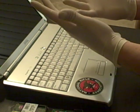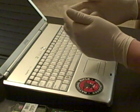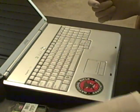In the video you'll notice that I am wearing gloves. That's just because the memory module can be damaged if there's a discharge from static electricity, so it's always a good idea to protect it from that.